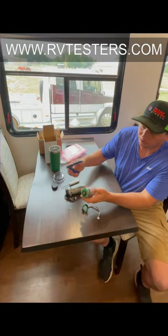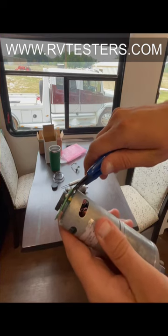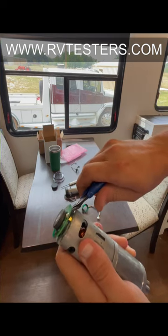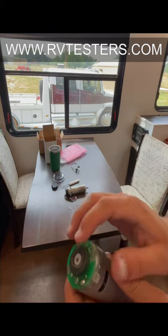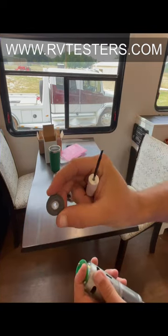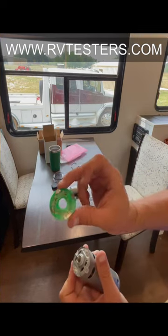So what we want to do is cut these terminals right on the edge of the board. I'm going to get up close so that you guys can see what I'm talking about. We're getting as close as we can to the board, and we cut once, cut twice. Now the board is free. Now it is time for us to remove the magnet. We come in here with that same little pry tool screwdriver and just pop the magnet up. Just note which side was up — usually it is noted with a marker right across the top. We take that off and remove the old board.